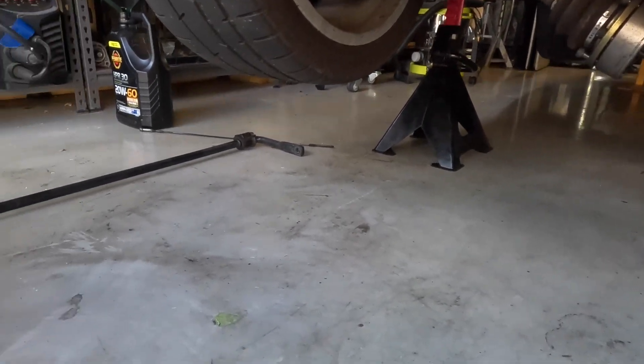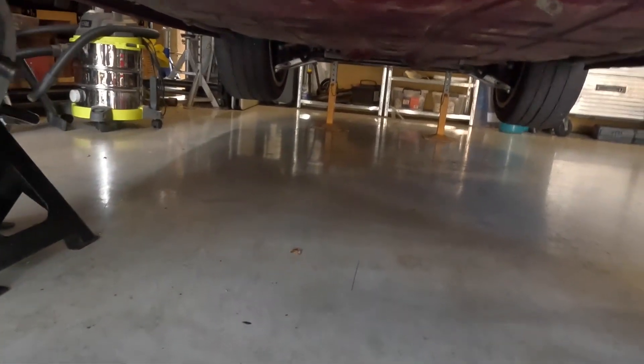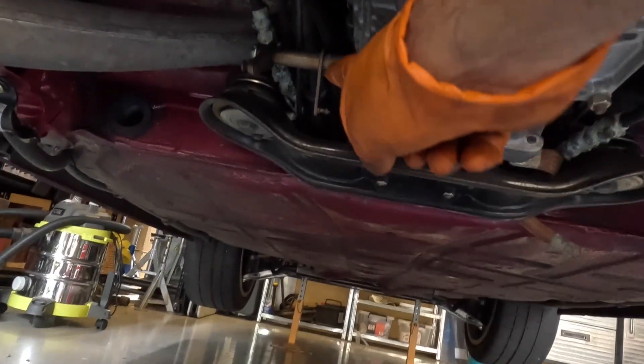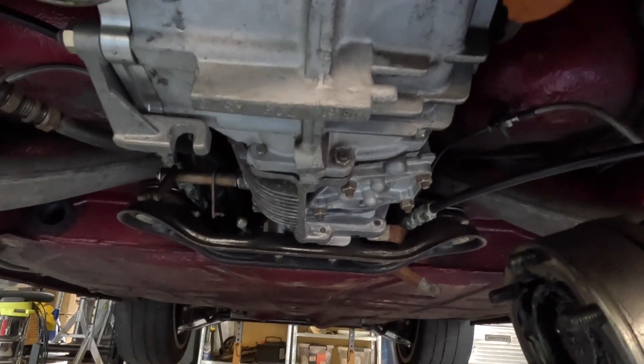Quick update underneath the car: as you can see I've removed the sway bar, and the driveshafts have been undone. I've also disconnected my clutch cable - it's out of the way. I've removed the throttle rod off that bell crank there, and popped off the linkage from the pedal. I've removed the clutch actuating arm. Underneath - it's dark but you can sort of see me pointing - I've removed the 13mm nut which connects the battery cable to the starter motor, and I've also removed the earth strap.